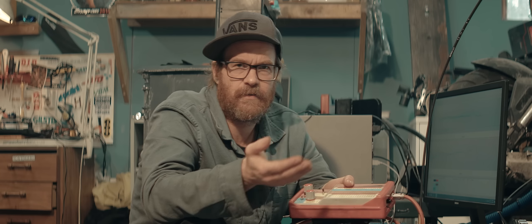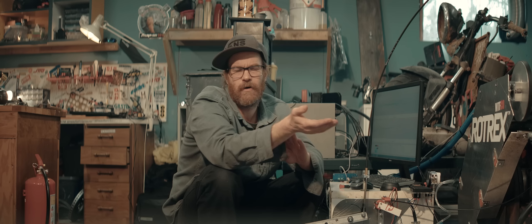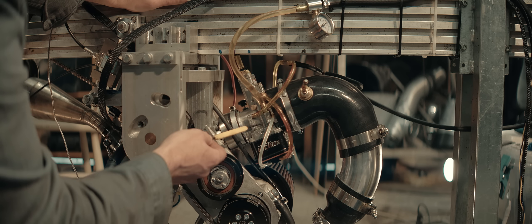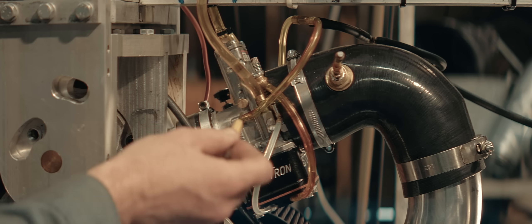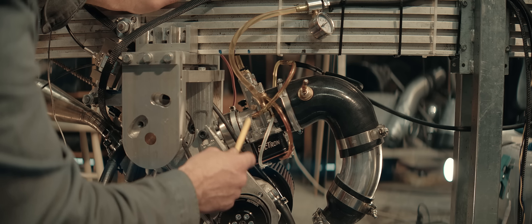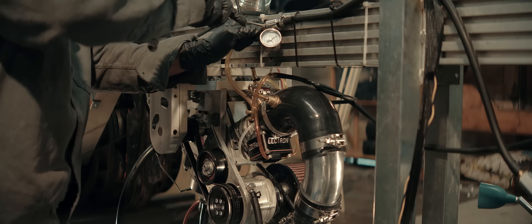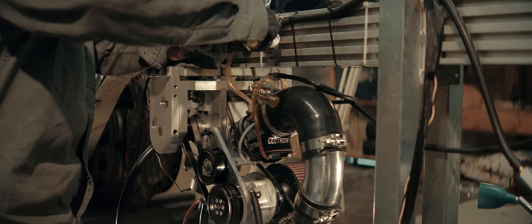There are lots of backfires and misfires though — it's still rich to the point where the ignition is probably not coping. I've got a monitor so we can track ignition while running. The carb is experiencing major issues: lots of fuel being pushed out in the split line between the two halves on both sides. Backfires seem to open up the gap even more, making the leak worse. I'll have to fix this — there's a low pressure area under the slide inside the carb, so fuel is probably not only being pushed out of the carb but also into the venturi. We'll need to fix this before continuing. I can tell it's running better from how much my eyes are burning — more combustion going on and not so much fuel just passing through.